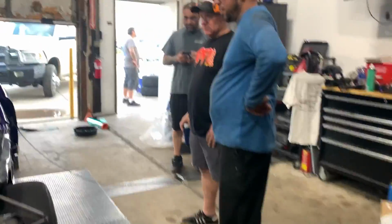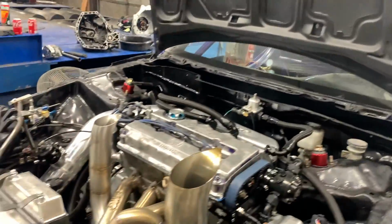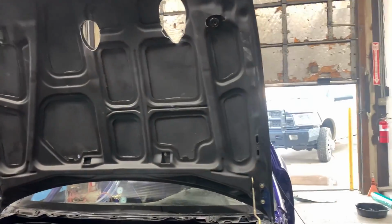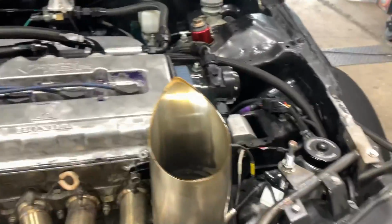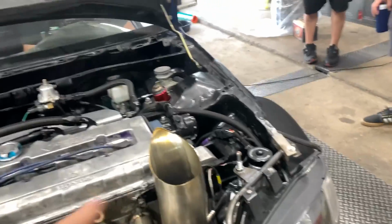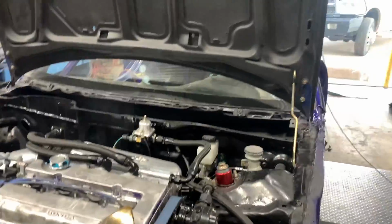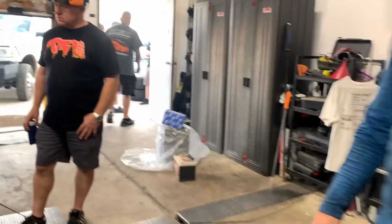Yeah. But you can see diesel, we still get that a little bit. So, yeah, I think so. That's what I thought. It only hits as soon as it comes off throttle. Poof. And you can still see it cooking. It's oil. It's oil. That's what they said. They got the restrictor in the turbo, but I think we should check.